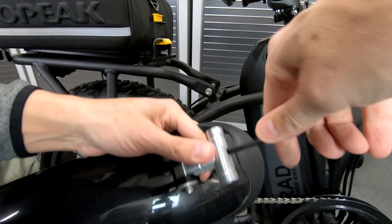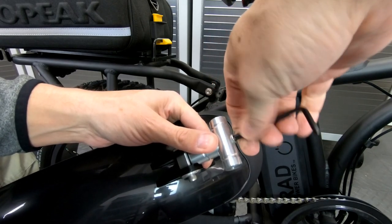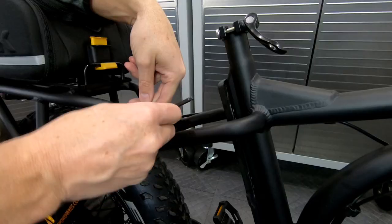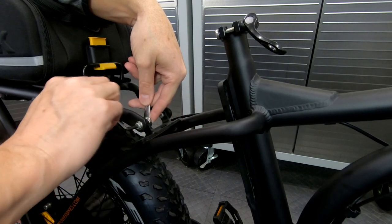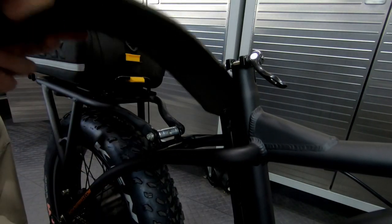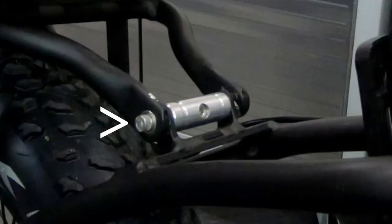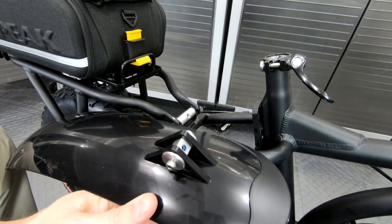On the rear fender, this mount — if I had an extra hand it probably would have been easier, but it also would have been smoother if I'd just familiarized myself with the bracket on the bench first. This is where the problem came: the brackets for the rack and the bracket to the frame weren't lined up properly, so I had to put a little force into them to get them to line up. You couldn't loosen the brackets to fix it — the screws were forced in with an automated gun during assembly. I was able to straighten it out and get that fender bracket in there, but this was tough and took me a little bit of time. It wasn't sloppy work on the part of assembly, but it was an issue.